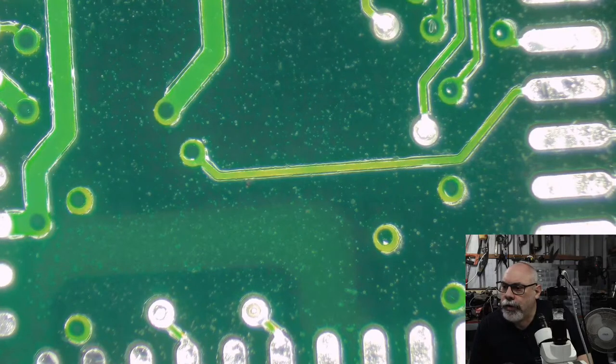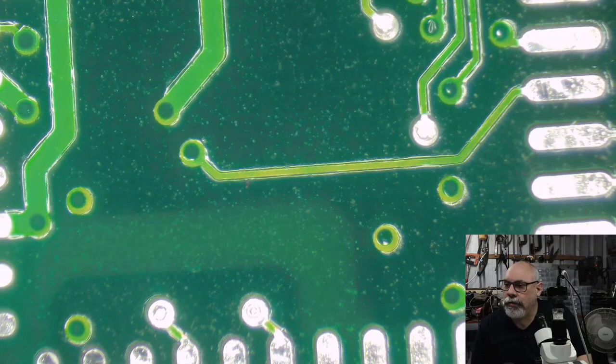Using hot air to remove the SMT electrolytic capacitor. Okay, so if there's a battery leakage on the 2Ci, how does the computer still turn on? It looks like it came from the back and shot all of the way to the... Yeah, well, how does it still turn on? Well, that's sort of... It might still, you know? When it comes to damage, you can have very small damage in a very crucial place and the computer will stop working. Then you can have quite widespread damage in non-crucial areas and the computer will still work, so...